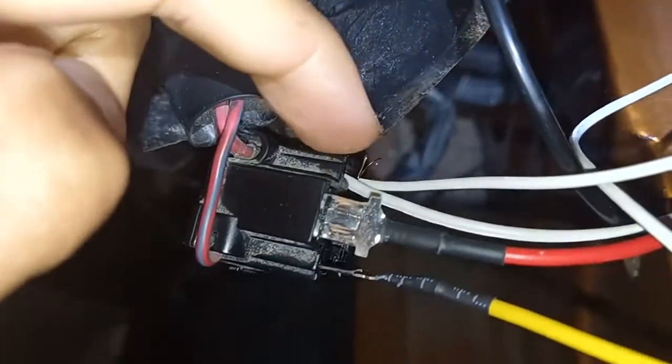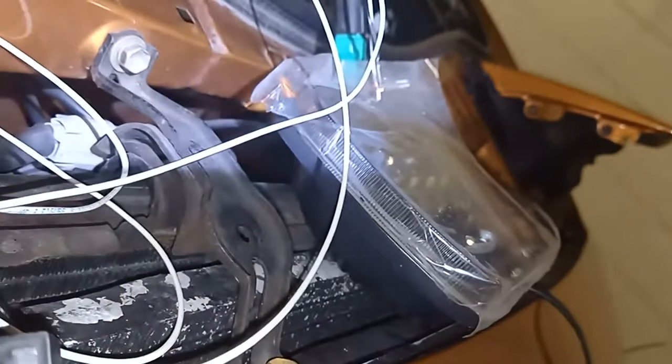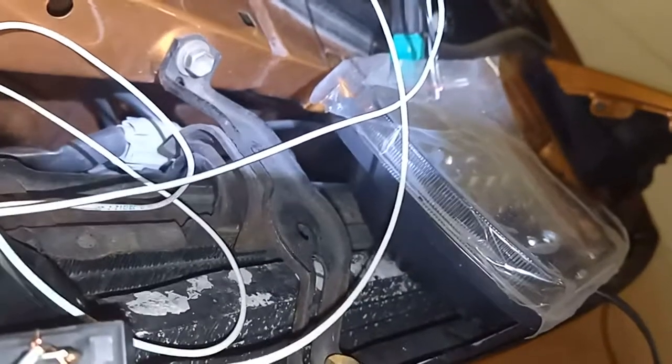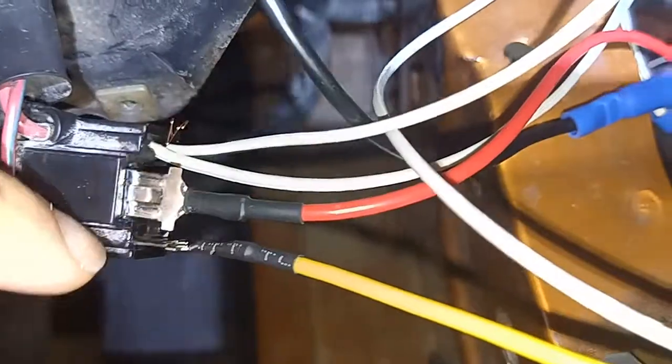And then as soon as you turn that constant power off, there's no power whatsoever, so it doesn't matter which earth you chose. The way you flip that over to put a positive switched aftermarket LED to a negative switch circuit is you use relays. And the first step first, the power goes to two pins. It goes to both pins 86 and 30. The selector, which is the earth, goes to pin number 85.